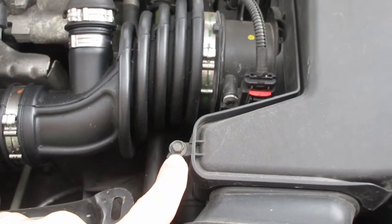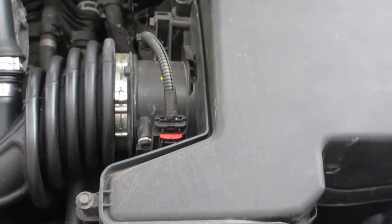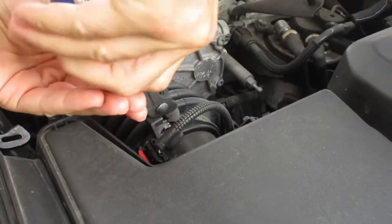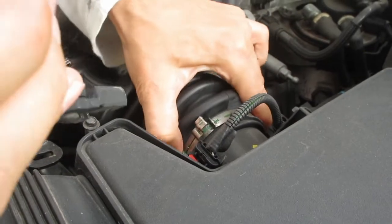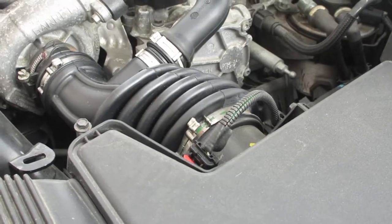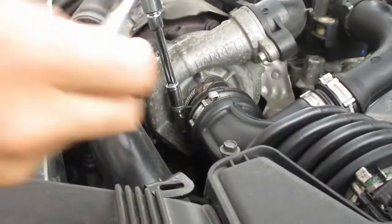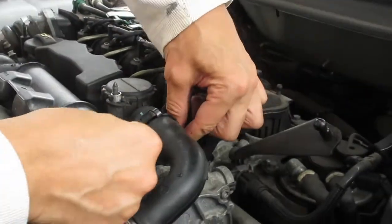If you're also replacing the air filter you'd need 7mm sockets to get into it. I'm not replacing the air filter because I did that last year and it's still good. To get this off we use special pliers underneath and pull it back to loosen it off, then pull the hose off. Probably best to wear gloves for this. Undo the jubilee clip — I tend to mark where the right torque is with a marker pen, there's a red mark there. Then these unclip on both sides to release.